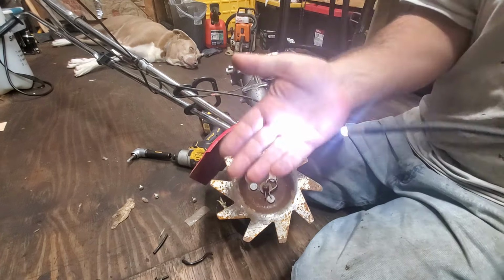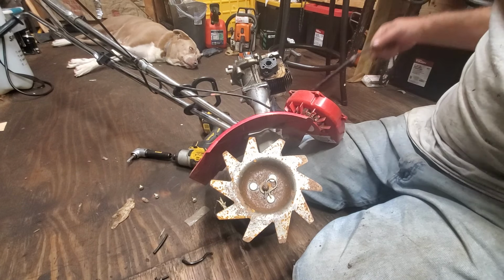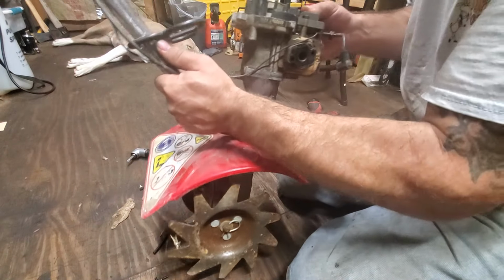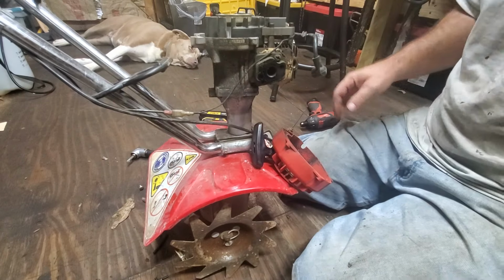It's just a large, thick black film of deposit along the cylinder wall, and that could eat up our pistons, so we want to make sure we get that off before we restart our equipment. So that's what we will do. That's going to be it this time of Shed Shop Working on the Floor edition.